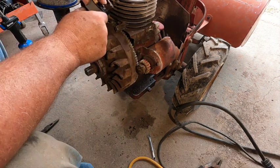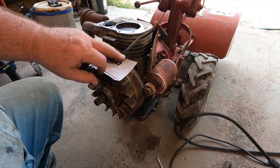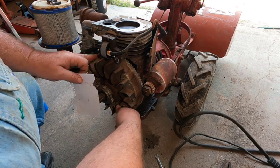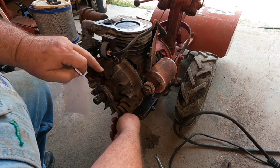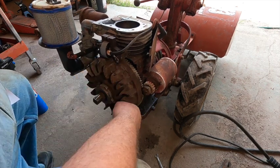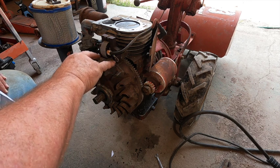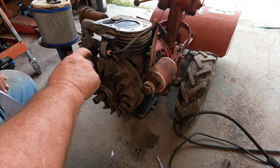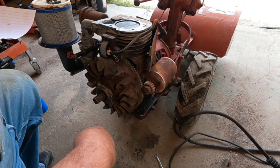The magneto wiring came off when I ground off the bolt head - I'll have to crimp something on there. I put a piece of paper between the magneto and the flywheel and measured the thickness - it's about 8 thousandths, and I think 10 thousandths is what we're looking for. But I also didn't clean the flywheel up, so maybe I'll get a thousandth out of that. The magnet goes past this coil, causes an induction, and creates a spark - and it's not hitting it, so I'm going to leave it at that. I'd like to have two feeler gauges - one on each side as I tighten - but I'll bank on the piece of paper for now.